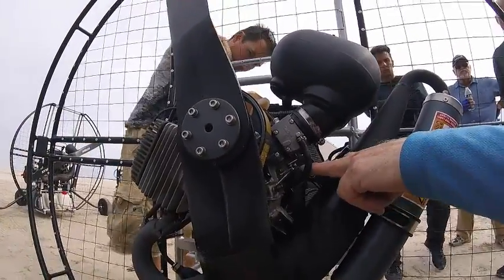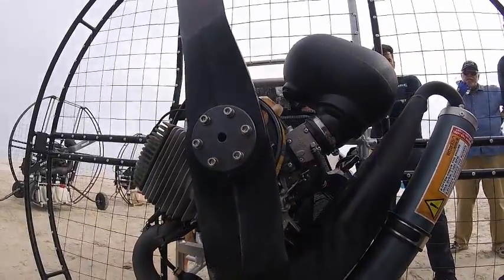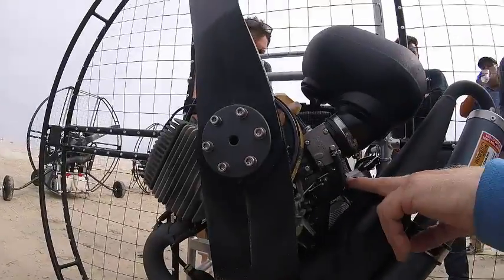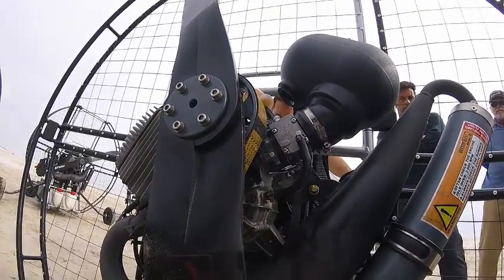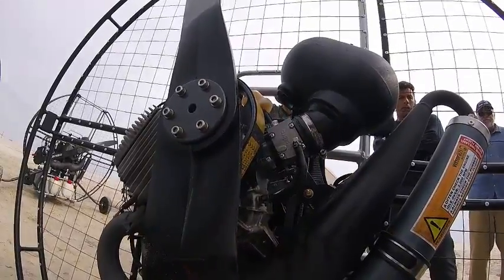You got to make sure that that screw is tight. You don't want your throttle cable coming loose in flight. That would be a major boner. Or an oopsie, sorry, not the terminology there. There you go. Okay, so that's good. And obviously, when you go to start it, you want to make sure it's not locked wide open full throttle. That's kind of a bad problem.